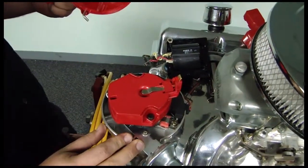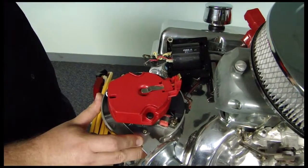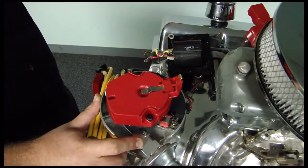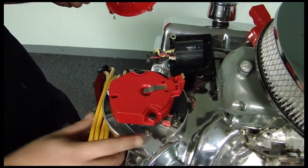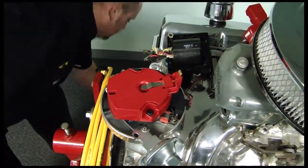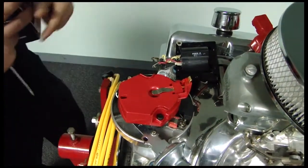So this will be a pretty easy cut and dry installation. However, if you're not already pointing at number one, what you can do is roll your motor over to top dead center. You can do that by pulling a spark plug out and feeling the compression stroke, or you can look on your balancer. Just make sure you're not 180 degrees off on the distributor. Now like we said, we're already set up pointing at number one cylinder.